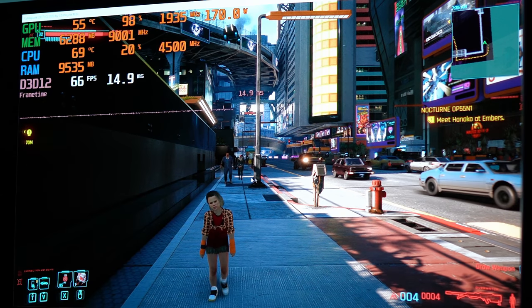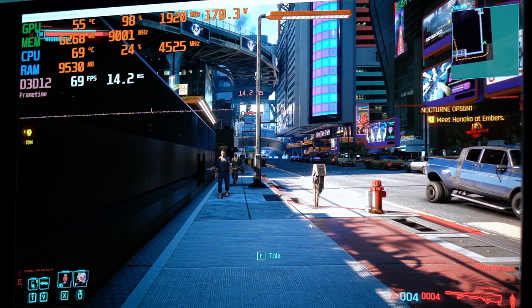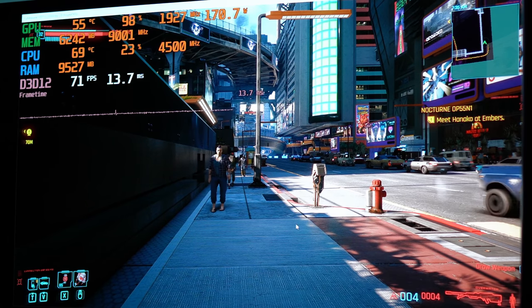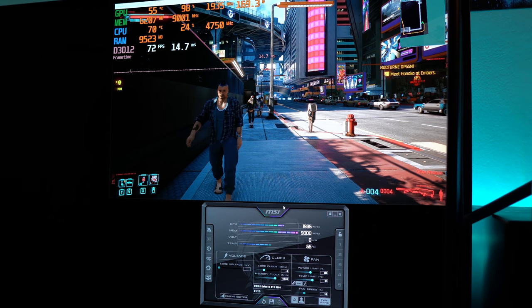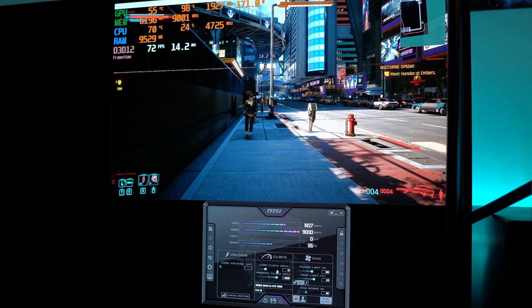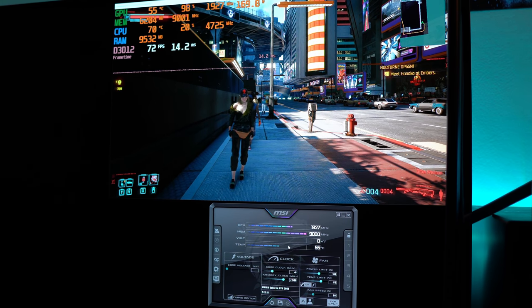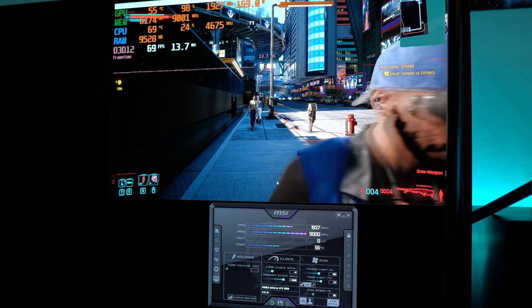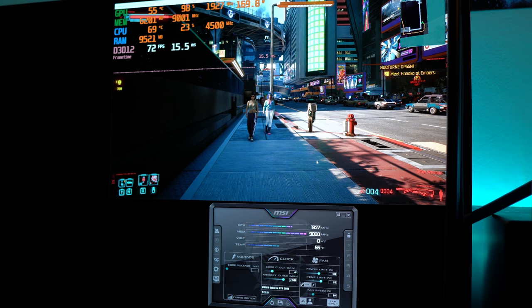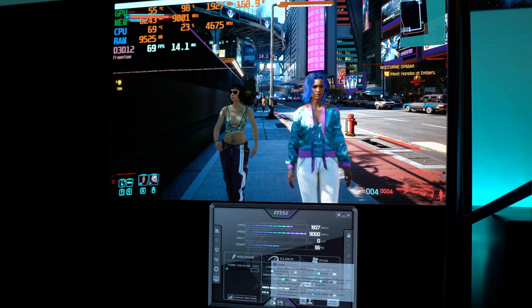Do you want to see some pretty sparkles? Do you see the little sparkles — are those picking up on camera? So when you see the sparkles, you went too far, guys. This is what you might do when overclocking a GPU — you might pull up MSI Afterburner, unless you're on a Radeon card where it's just built into the driver software. The sparkles we're seeing are visual artifacts of me pushing my memory clock too high.